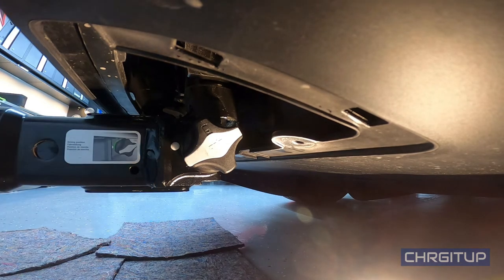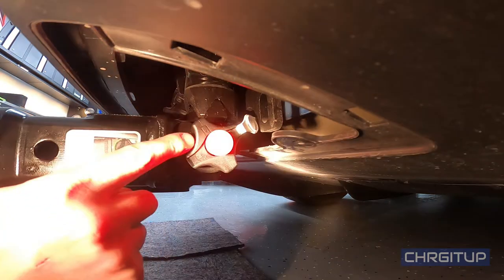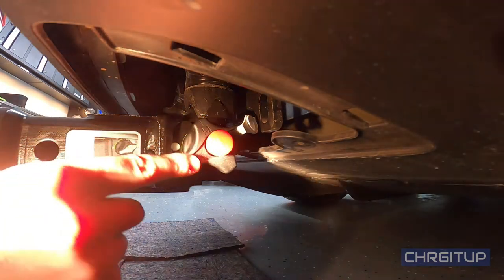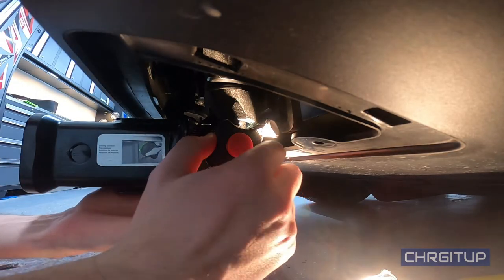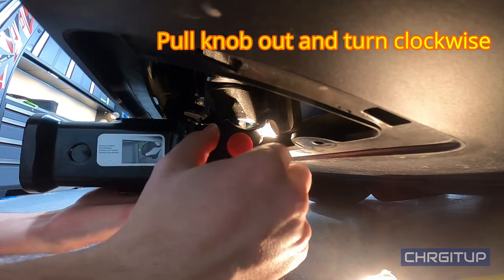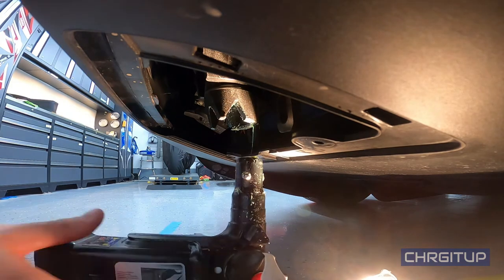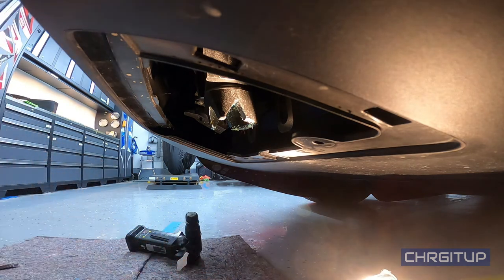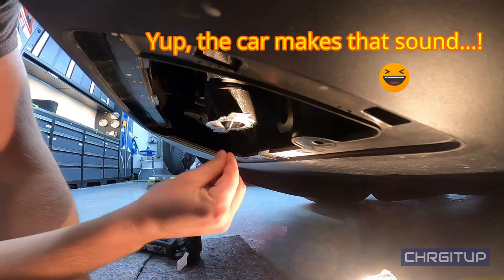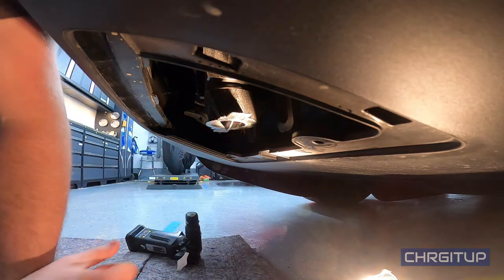Some people keep it on there, but I'm going to show you how to take this off. Take the key, pop up the dust cover, pop the key in — right now it's on the lock position, that's the unlock position. Turn the key to unlock, hold it, then pull it out and turn clockwise. As you do that it'll release, and it falls right back in. There is going to be a lot of grease from the trailer hitch portion.